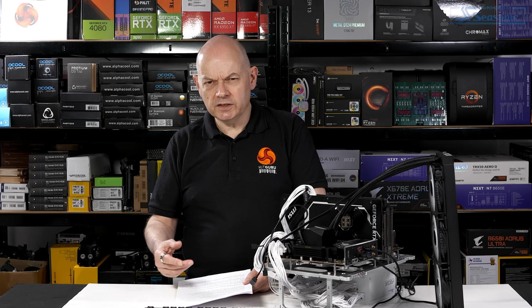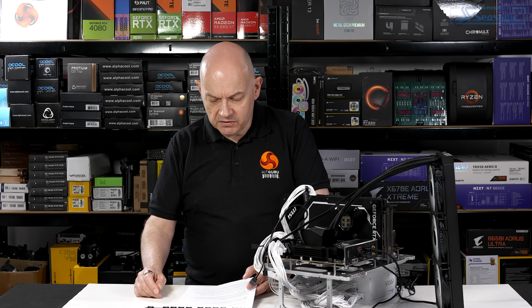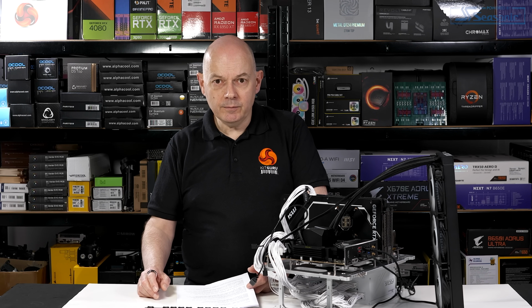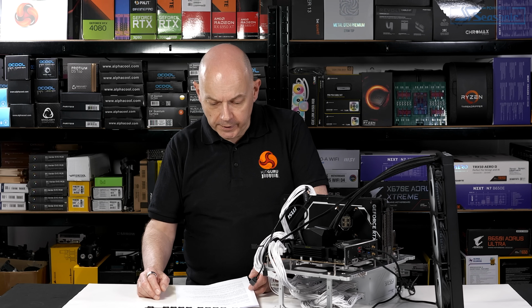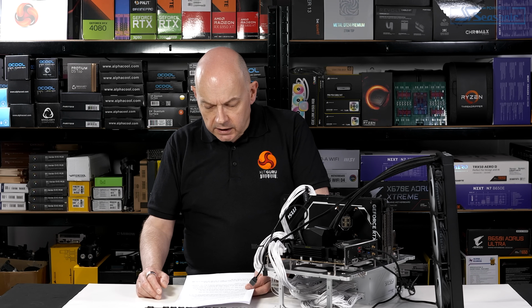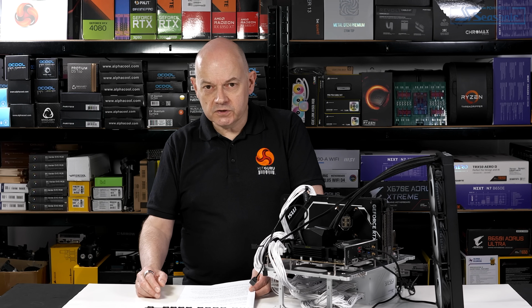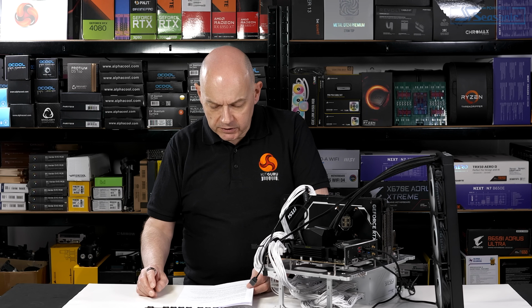That's the default. It's also been called VBS. It means everything runs in a sandbox and it can affect performance. It particularly affects game performance. Various game launchers regard core isolation as some sort of malware. So you want to be clear about that. Is the Windows power plan running on balanced or high performance? That was a big point to me a couple of days ago. Now I don't think it much matters.